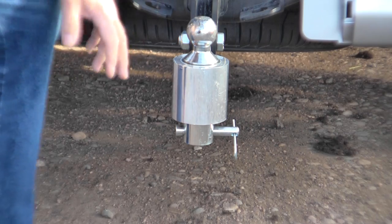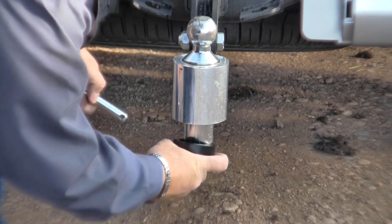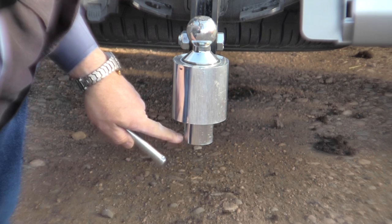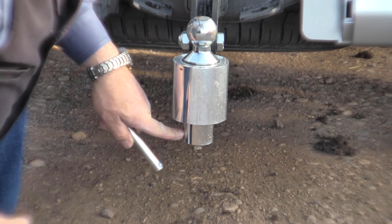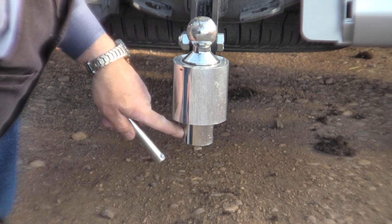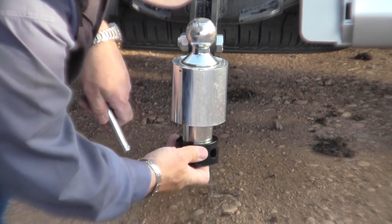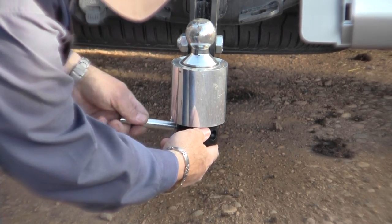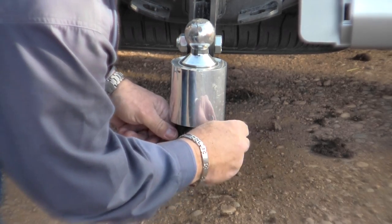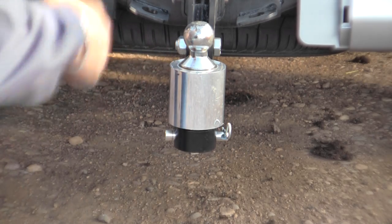After you've taken the weight distributing hitch off the ball, you have an adjustable coupler. It comes with a ring that slides on the bottom of the shaft. You can see how thick that shaft is — it's a lot thicker than an inch and a quarter. This comes with a 2 and 5/16ths or a 2-inch ball. The 2 and 5/16ths is rated 14,000 pounds; the 2-inch is rated 10,000 pounds. When you're going to use it as a regular coupler, just put the sleeve on it, run the same pin and hair clip through it, and you're ready to tow. It's a versatile product from the guys who make the Rapid Hitch.